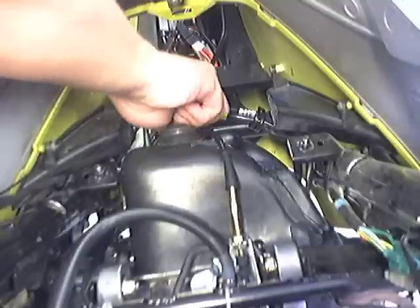We had the scooter out, we took it for a spin, seems to be running pretty good with the setup that we had with the Malossi. It is an extra 750 RPMs over what we had before with the setup we had. So now what we're going to do is go ahead and check the plug and see what it looks like, see if we need to go a little bit richer or leaner.